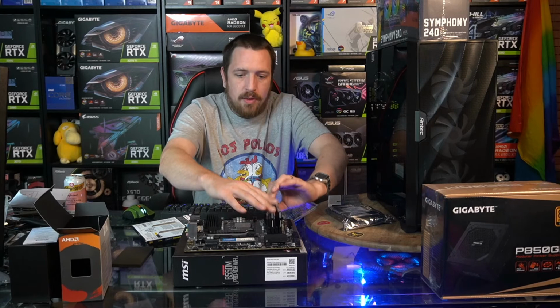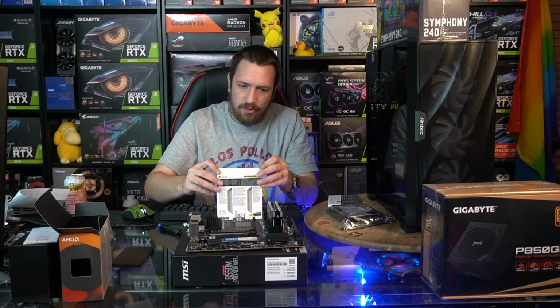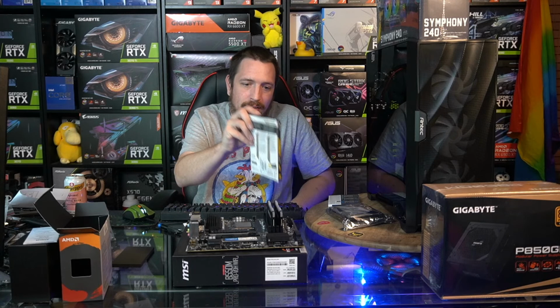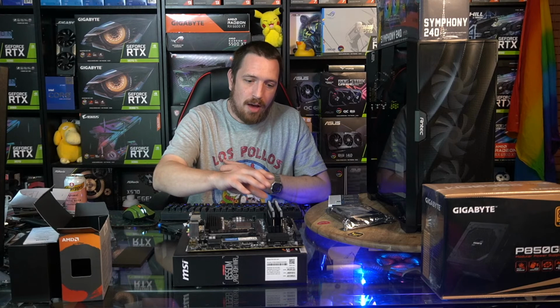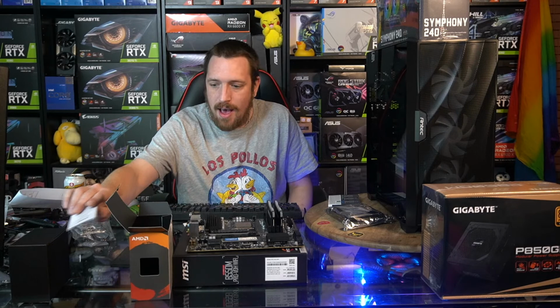And so you always have the sticks in slot one of each individual channel. So there's two channels there over four slots, so that's why they're a slot apart. And the reason is the CPU can talk to both channels at the same time, so there's a latency improvement by having your memory in two different channels there, split across the two. So that's why you see that configuration coming up again and again in all sorts of PCs all around the place, because of that latency improvement with memory, which affects how smooth everything seems to run.